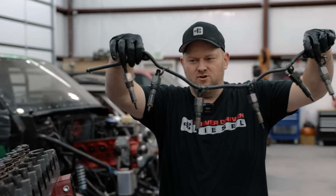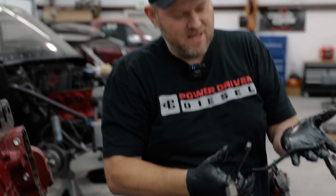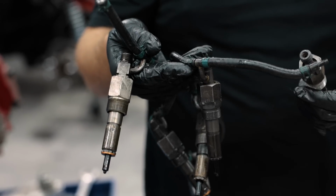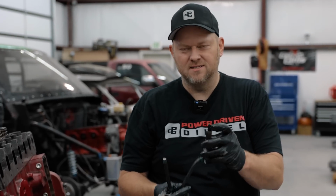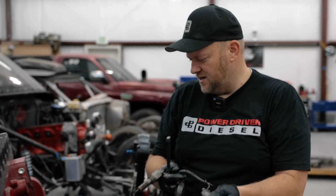Look at that, tractor technology on the old 12 valve. So this rubber hose is the return line because they don't have the hard return lines like stock. They've got these big nuts so that they can anchor these longer bodies and these huge DT style nozzles.